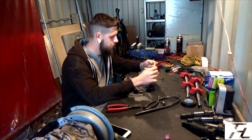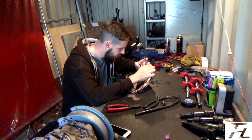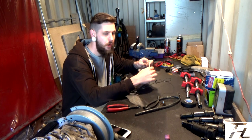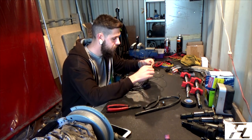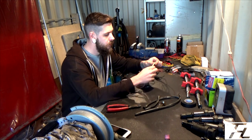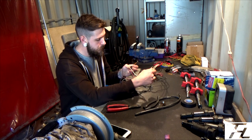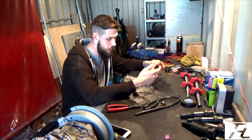I can see that on the plug there's the black with, is it a white, is it a yellow? I'd say yellow. The black with the yellow stripe down it. Different variants of SR might have slightly different wire. But that wire goes into 3 whites and 1 black with a yellow trace. So they are the powers for the coil packs. They will go into the middle pin on all the plugs for the coil packs. And that's pretty much that one.